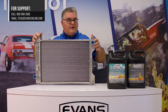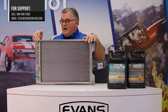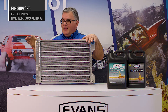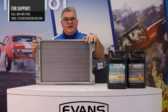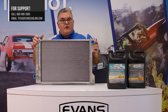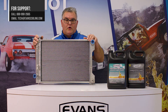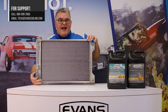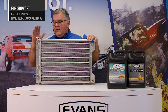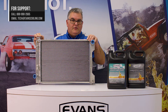This is a crossflow radiator, aluminum — this one from a Plymouth Prowler. This is a little bit different situation. The cap location is on the suction tank. This is the side which sees the cooler coolant, reduced pressure from the coolant traveling across the core, and also the water pump is acting on this to pull fluid from it. This cap location sees much less pressure in general than the downflow does.